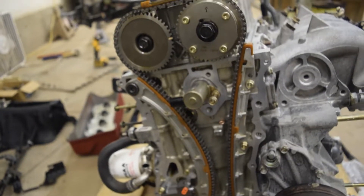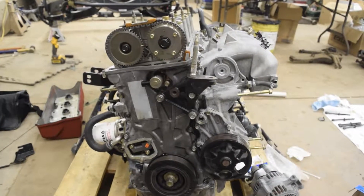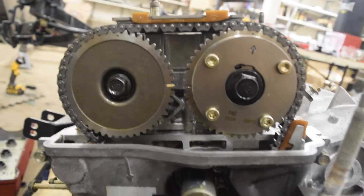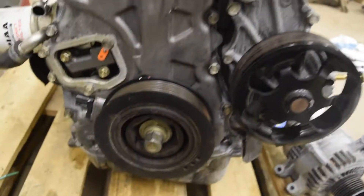I think that's it for today. It was really cool — first time doing a timing chain. Worked out pretty well. Look at that — got all the timing marks right. Top dead center. Even spun it. Got the crank pulley on there. Got the cover on with all the silicone and crap.